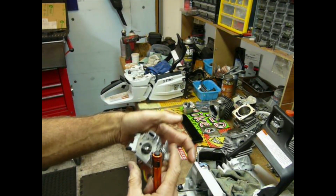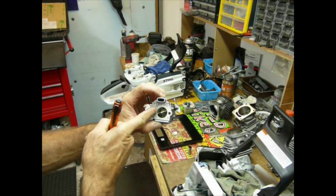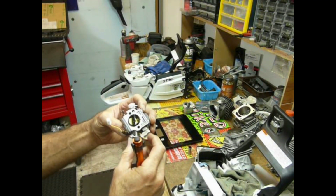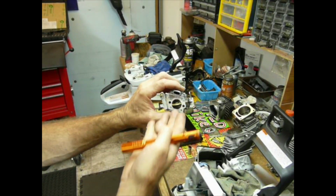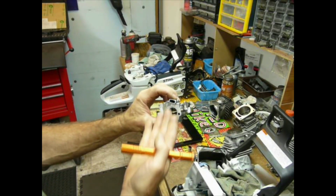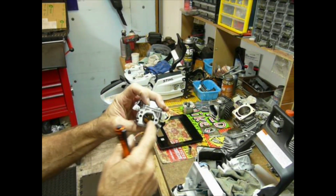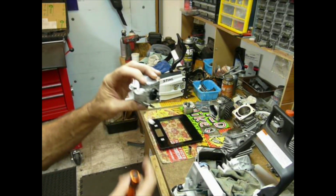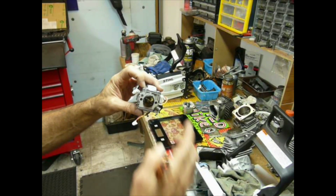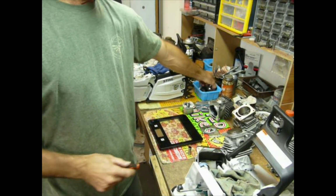It's actually cast. Husqvarna uses a little plastic piece in there, but the bottom part of the Venturi is actually separated from the top part, and the shutters actually interact. There's a recess in the shutter cast in there, and basically close the top to the bottom from intermixing. And we can see they changed the little ring that goes into the start of the boot intake manifold, splitting it as it goes out a little bit further. So definitely different in that aspect.